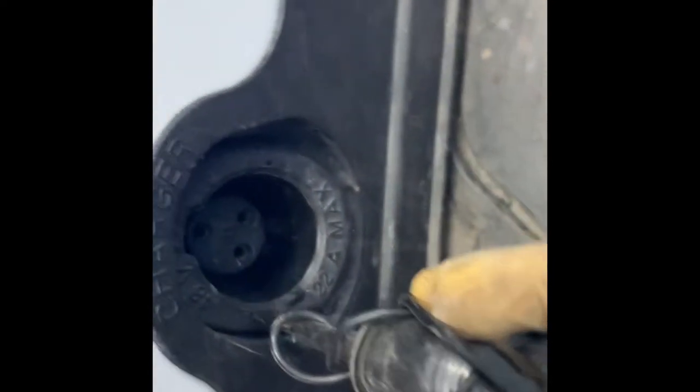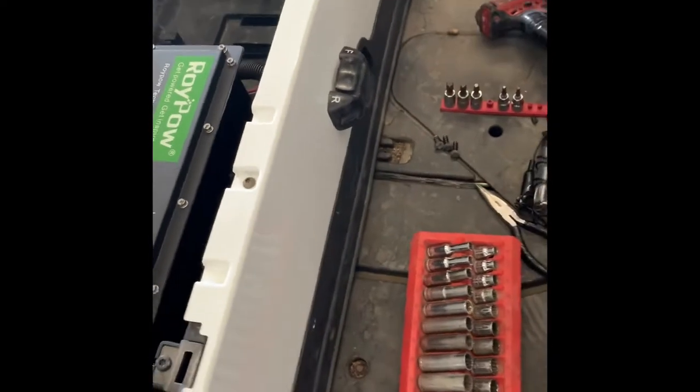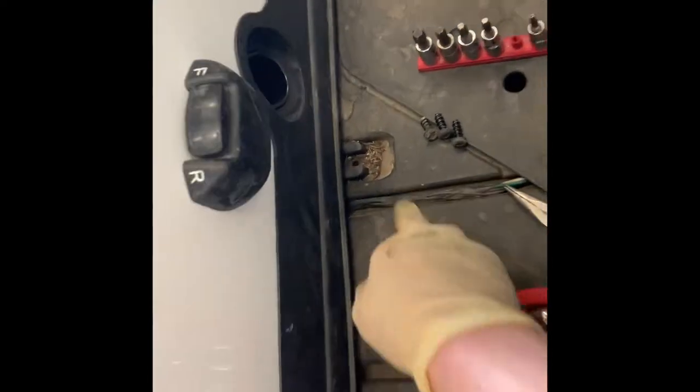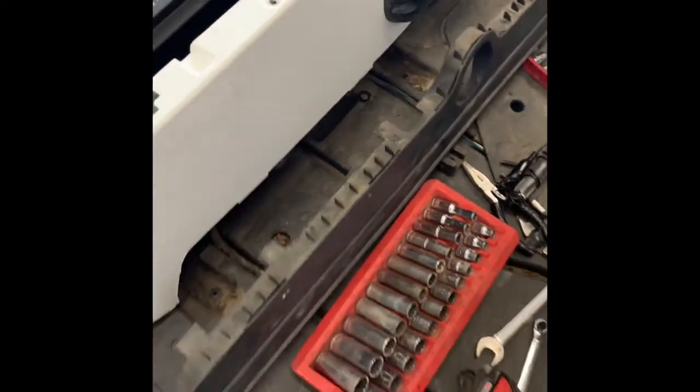Now that we've got the three screws out, we're removing this plastic piece. You just need to get something sharp, put it right through those holes, and bend it outward — see how it came out? Then do it on the other side and it's loose and comes out. I typically like to take out these two screws right here so I can grab it and lift it up to maneuver it out — it's easier if you do. With the two screws out you just lift this up, slide it outward, and slide it out from underneath. Note it has teeth on it, so it's a bit of a struggle to get back in if you don't take those screws out.